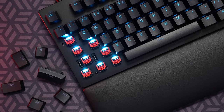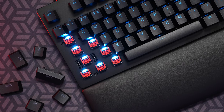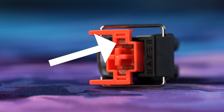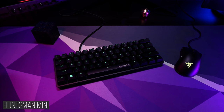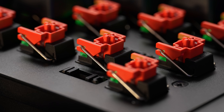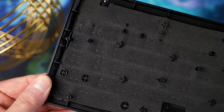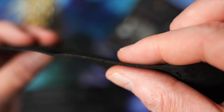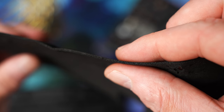These have been through some revisions over the years. The original reds on the TE were super loud. When they dropped to 60%, they added silicone dampeners and factory lube. This definitely cut back big time on the bottom-out and return noise, but each of these switches has its own stabilizer wire. Without the loud clacky switch sound to drown out some of that wire noise, it left the Mini with this weird rattly sound on every key. I'm happy to report that the addition of the acoustic foam inside reduces this noise quite a bit — it's not even crazy thick foam, but it makes a big difference.